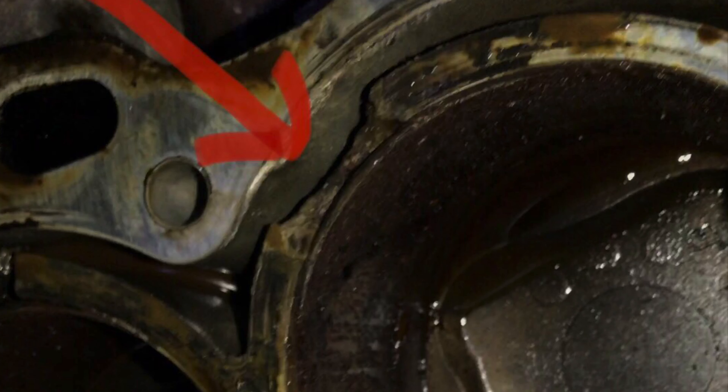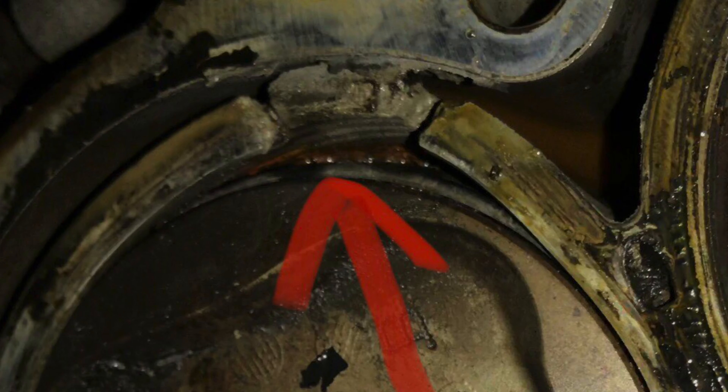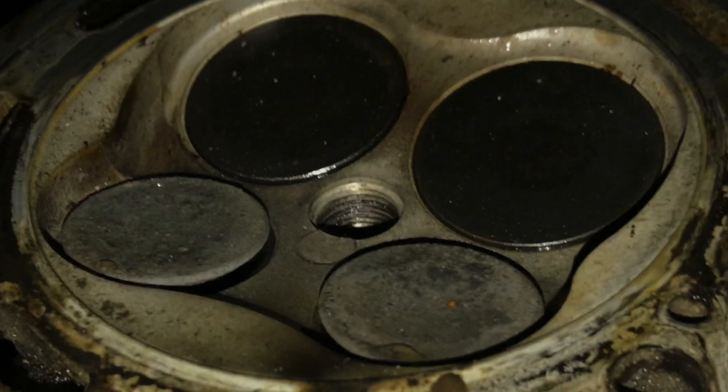But what? Ooh, look at that burnt valve. It's all stuck, apparently. It looks like it is. Let me get a better view on this — I'll tip it up here. I'll take a quick peek in there. Those ones look fine, I guess. You know, I'm no expert here, but I know how to spot big problems. There's another valve that's kind of poking up — does that mean it's stuck? I kind of think, since there's no spring pressure on any of these, that they should be returned because the lobes aren't pushing down from the cams. So they all should be flat and seated.